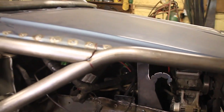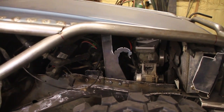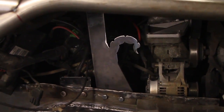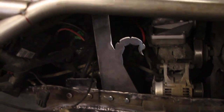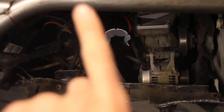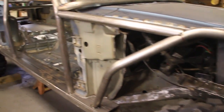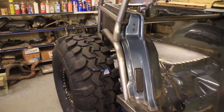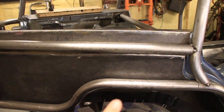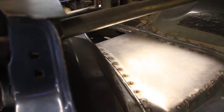Up here — I'll pop the hood in a minute — but I've got a bar running through there. I've got some plate holding and supporting it with a little scorpion tail cut into it. But that's going to be hidden because the shock is going to sit about like that, and you'll just see the scorpion tail kind of hanging out behind it, very subtle. The rear ORI is going to be up at an angle, coming up inside the fender — I'm going to cut a hole in the wheel well and come up right there.